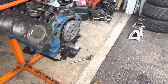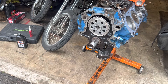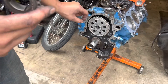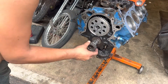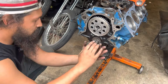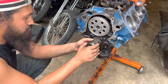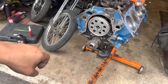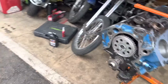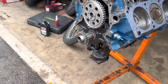The first thing we gotta do is press the crank gear onto the crank. A lot of the time these will slip fit and go on real nice and easy — sometimes they don't. I know from doing this last time and testing all of this, this is not one of those quick and easy ones, unfortunately. It's a little snug but that is okay, it will go on. I got it started on the keyway so I'm gonna have to drive it in a little bit. This one is a little snugger than the last one I did, but not the end of the world by any means.